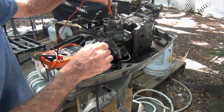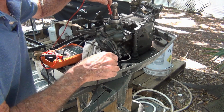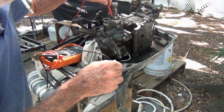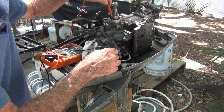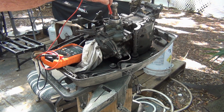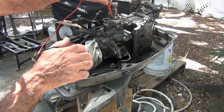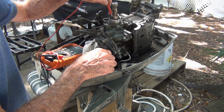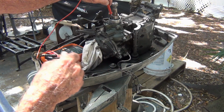But if you touch this pan, like I said, I'm touching bare metal right there, the spot where the paint's been scratched off. Nothing. Weird, right? But I'm getting it on that bolt, and that's got the shock absorber on it. So that's a possibility. It's just weird, you know.